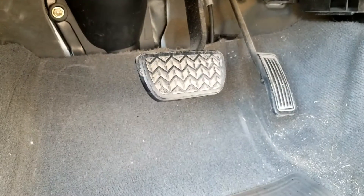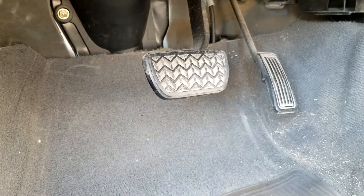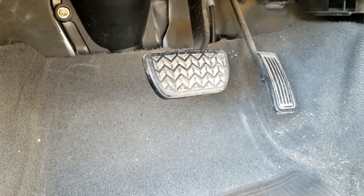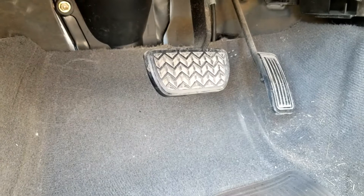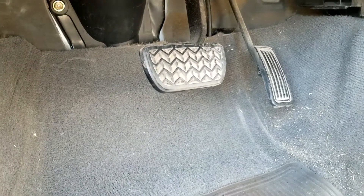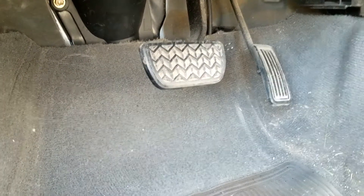How do you test that the brake booster has failed? There's a simple test you can do. With the engine off, you pump the pedal about three times to discharge it, then you hold the pedal and start the engine. If the pedal goes down, that usually means it's working. But if it stays hard when the engine starts, that usually means it has failed.